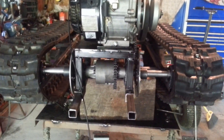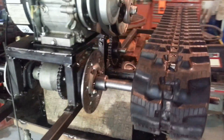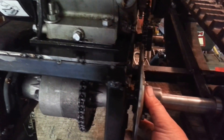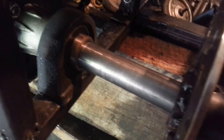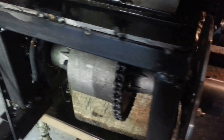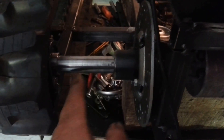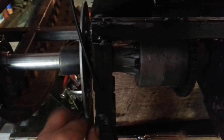I put the engine up on a stand a little bit, ran the jack shaft behind it, and I'm running my go-kart hubs here. They're going to be real close to where the engine is. There's also a little keyway in there — a little half-moon keyway right in there — and I'm going to run it close on both sides, unlike the others that run them out a little ways. My reason is that this Peerless axle is not keyed all the way; it's only keyed partway, but I think it'll be good enough.